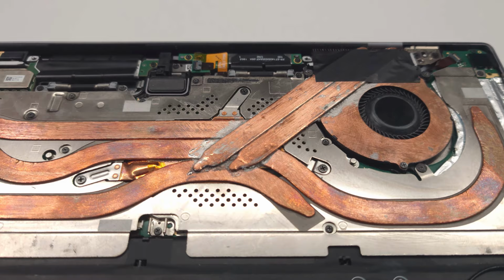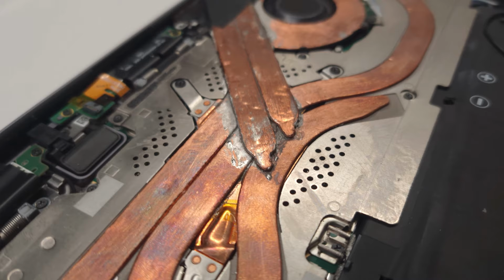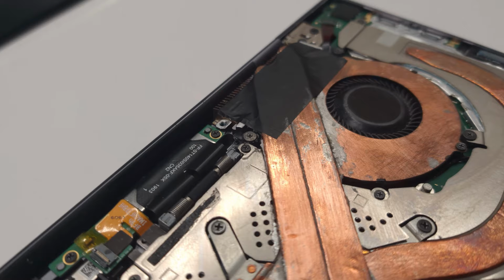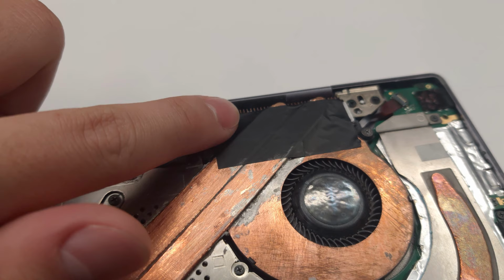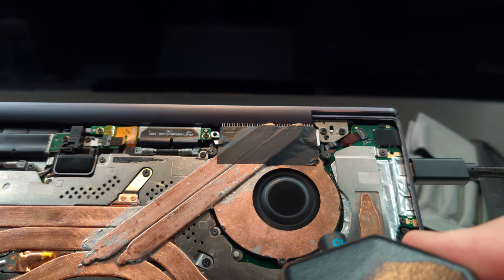First of all, it was very tricky to solder the copper well. So the thermal connections between the original heatsink, the heat pipes, and the added heatsink are far from perfect. Secondly, because of the arrangement of the heat pipes, not all of the fin stack is directly covered by them, so some portions of the fin stack are cooler than we'd like. We need the fin stack to be hotter than the exhaust air that's already in the laptop, for it to do something other than just block airflow. This may not be true for all the fins.